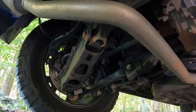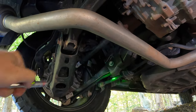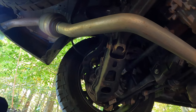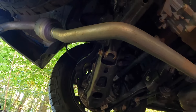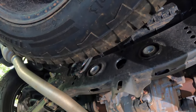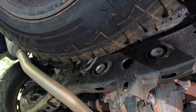Now, as you can see over here, what in the world have we got here? Well, that's another part of that link. That sway bar is there, attaches via a link here. There is your shock absorber right there. So it's a real potpourri of stuff that they've got going on back here. And this subframe in particular, right along here, runs transversely across the chassis and affixes both sides of the chassis to the unibody. Everything looks very, very well reinforced.